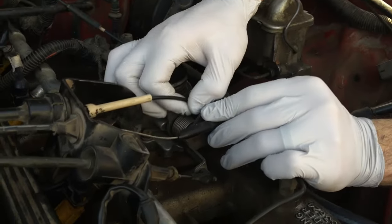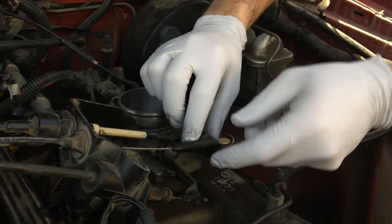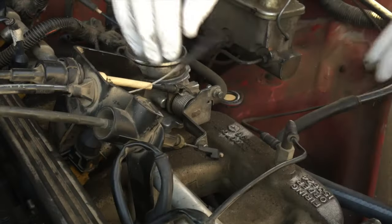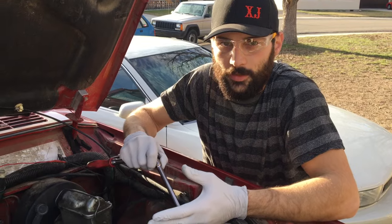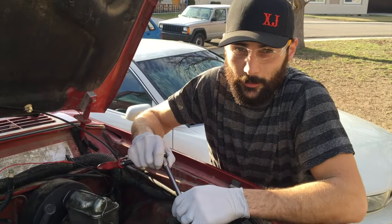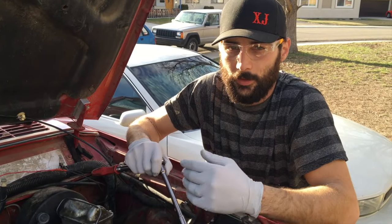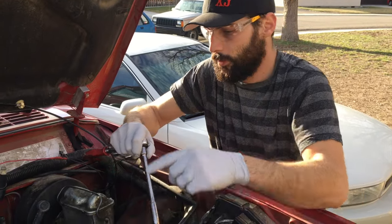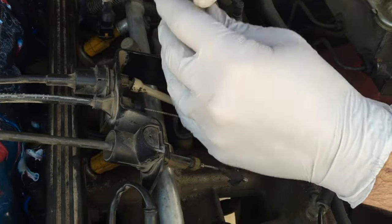These guys just be very careful and should just pop right off — they slide, just like that. So now what we got to do is actually remove the cable hold down from the intake manifold. There's going to be three 10 millimeter bolts holding it on. For those of you guys who are running the newer intakes from the 99 and up, I believe you only have two. They're going to come right over here — there's going to be one, two, and three on the older styles.